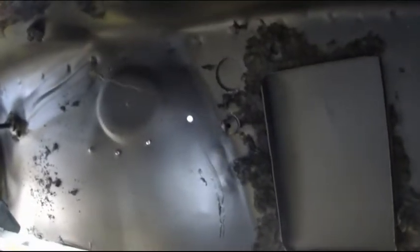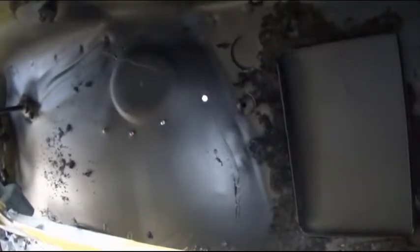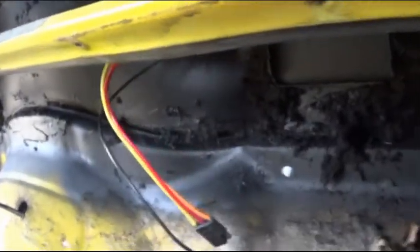So you're just going to want to spend a little bit of time on your project and see where you can find a good location, because you also have to remember the heater ducts are going to come off of it and go to where you're going to put them. If you've got a defrost unit, you're going to run them up under the windshield, right in front of the windshield. If you've got the heater ducts, you're going to run them somewhere out on the dash. So you want to make sure wherever you mount the box, you'll have plenty of room to run the ducts. Right here, it'd be bad, because that's as far back as it goes and you're not going to get the glove box close. So make sure you spend some time and figure out where everything's going to be